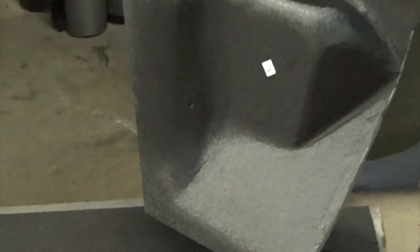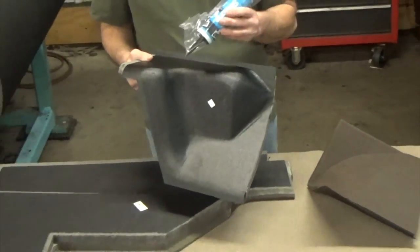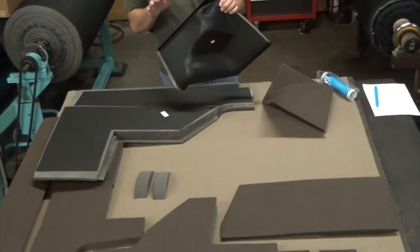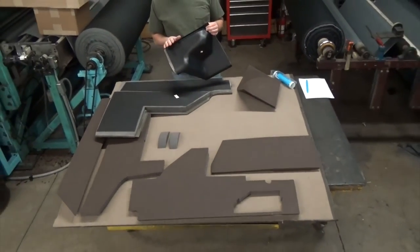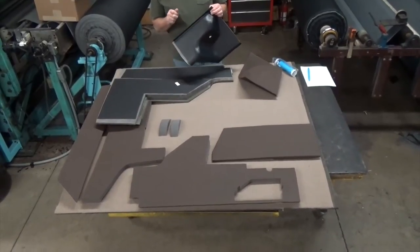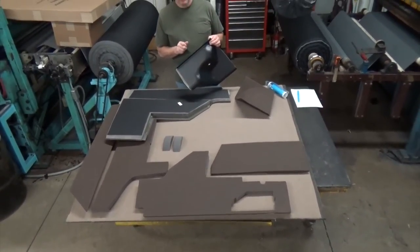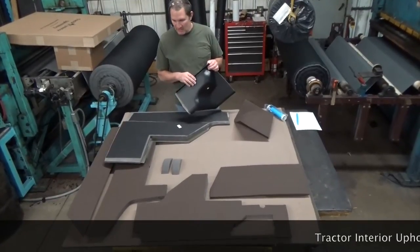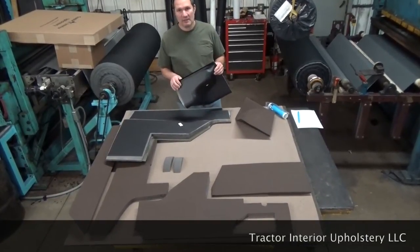You put a little bit of silicone sealant on these parts, place them in the cab, and you can work them around to get them exactly where you want them. With the glue-in types, once the adhesive is applied properly, they're very difficult if not impossible to move. With these, you have a lot of time to wiggle them around and get them in there.